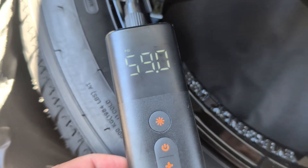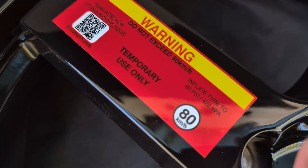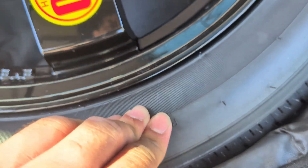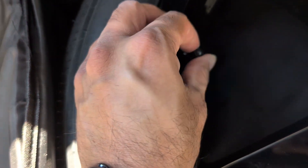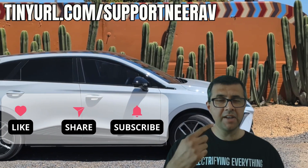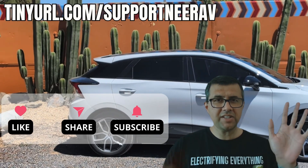So make sure if you have a space saver spare wheel, don't just leave it stashed. Make sure you pump it up at the same time you check all your other wheels — up to 60 psi, or whatever it says on the warning sticker on the space saver spare wheel. Keep it that way and it will be ready to go next time you have a flat tire or your tire wall rips because of construction junk left on the road. Thanks for liking, subscribing, and sharing my videos — it really helps me make more videos like this for you. Have a look at the suggested videos up above — I'm pretty sure you'll like those as well. Thanks and see you later.